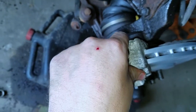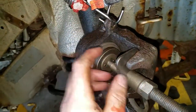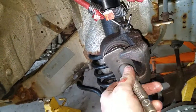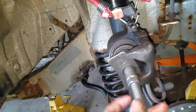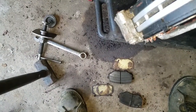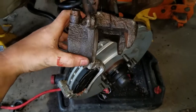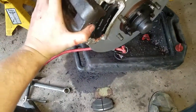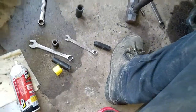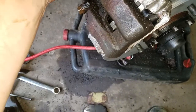I am going to get those two bolts tightened up and then I will come back. Alright, we have those two bolts tightened up. Next what you are going to do is take the caliper itself up here and remove your tool that you used to push back the piston. We got that out of the way. Then you are going to un-bungee it - be careful about the brake cord. Here it is, and then you are just going to slide it right down on over the brake pads. Be careful to push these rubber boots back so you don't mess them up - there is one down here as well. Next you are going to want to grease up your slides and put them in and get that tightened up.